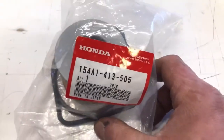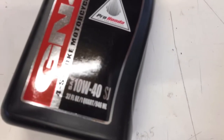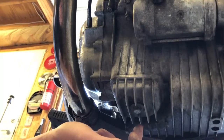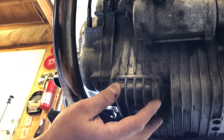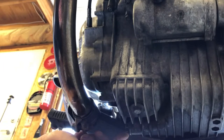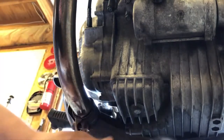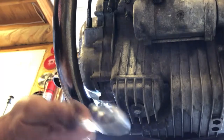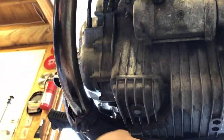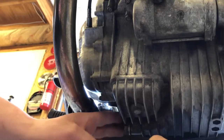Oil filter — there's a part number. And this is the oil I'm using: 10W-40 SJ. This is a twelve-millimeter bolt — that's where the filter is. And this is a seventeen-millimeter bolt — that's the drain plug. I'm just going to crack it a little bit to loosen it, make my drain pan under there, and say a little prayer. I'll start taking this out and we'll see what happens. Washer looks good. I'm going to loosen the filler cap a little bit — that'll allow it to breathe.